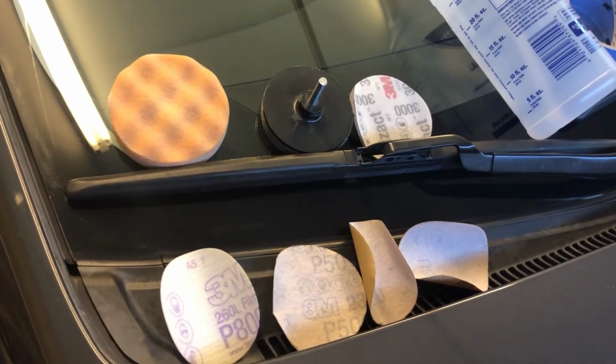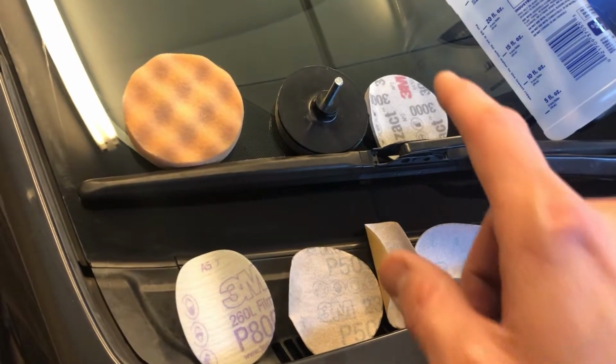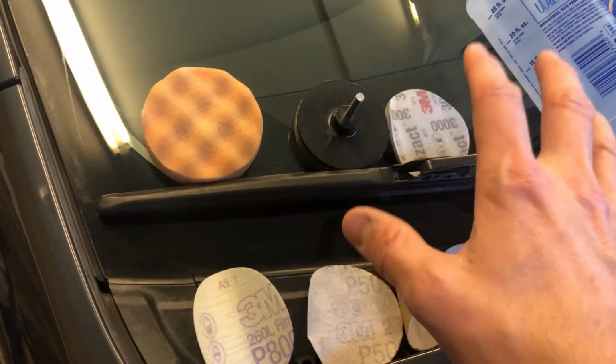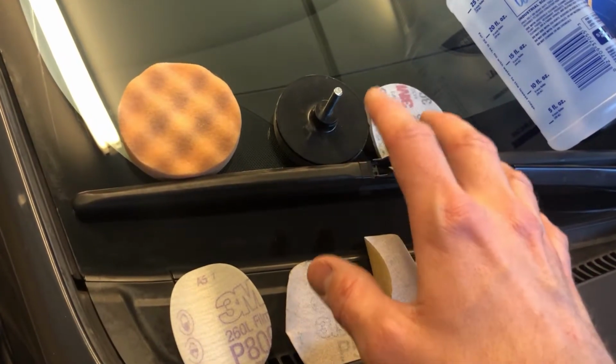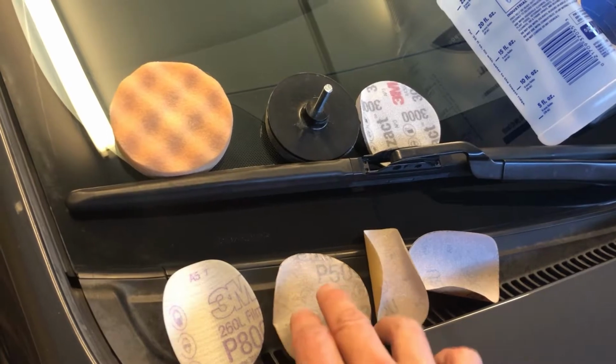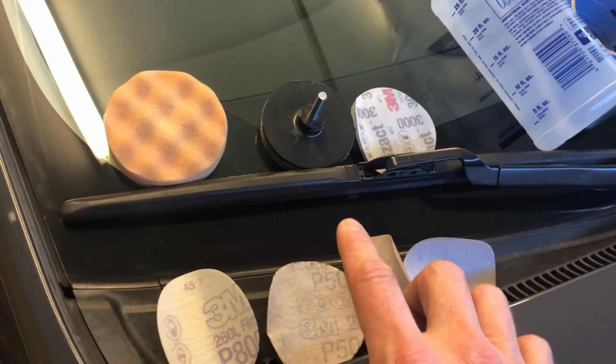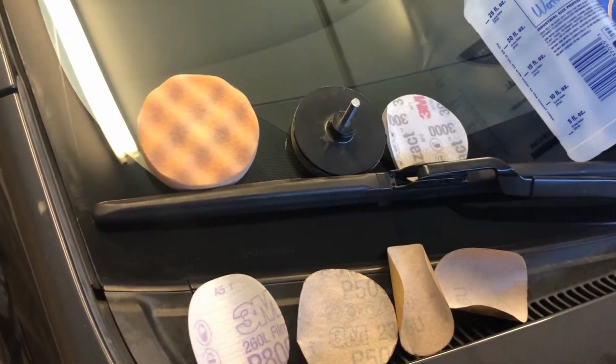And I bought that, and it brought them back to looking brand new. So what I did is I ended up going through and you just put it on there. You take a drill, just a standard drill, and you go through the different levels. So you start kind of abrasive. This one has a 500 grit, and then it works its way all the way up to 3,000. I think there's even an 8,000 in here. And then from that point, you switch over to a compound and you do it that way.